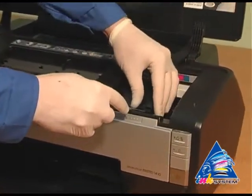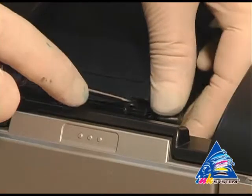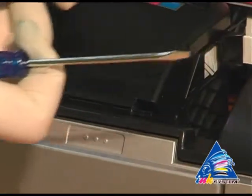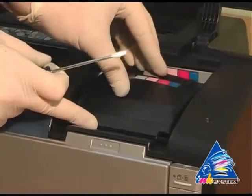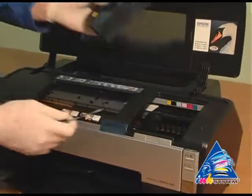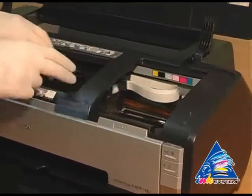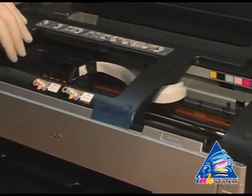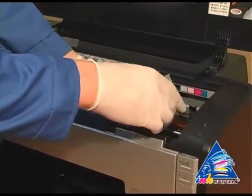With the help of a screwdriver, uncover the cap that covers the cartridges on the printing head. Move the carriage to the extreme left position. Put the cartridges into the printer in the way shown.